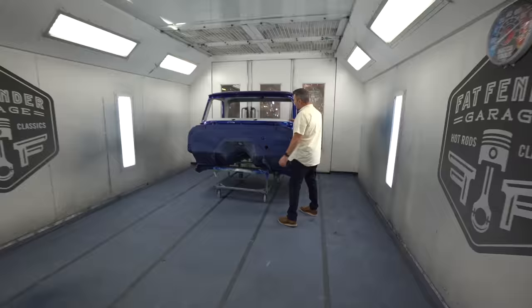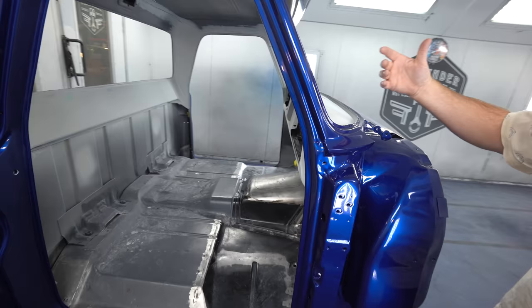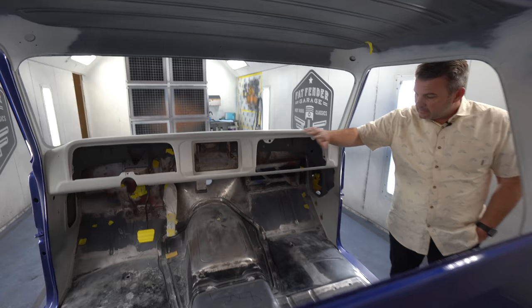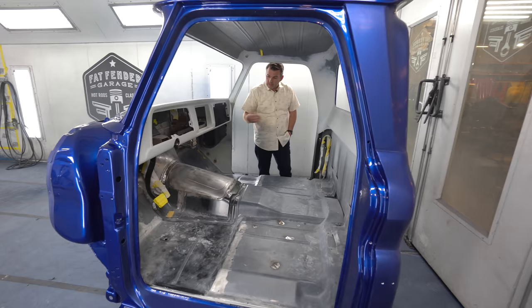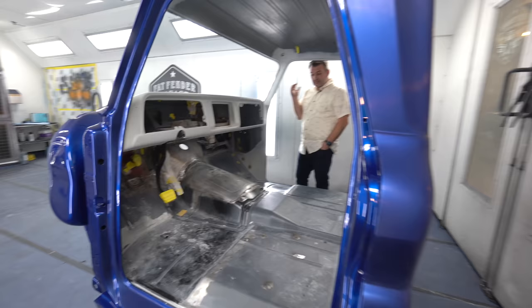Let's go take a look inside. This is ready to be buffed, but they're going to stop and paint the inside of the cab first. They'll paint this up here — it's actually not that much to paint. Then we'll black out everything else, clean up the bare metal, probably put a little SEM rust inhibitor on it just to kill the rust, clean it all off, black it all out, and then use the Restomod membrane material — which we've already shown in the video — on the firewall. They actually have a thicker material for the firewall specifically, and there really isn't anything else on the market quite like it.